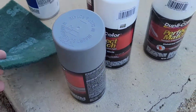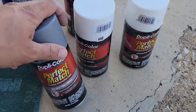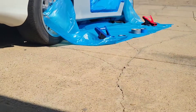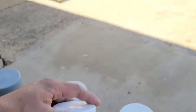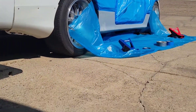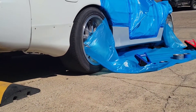I already primed it. What I did was wipe it off with a towel, then went over it with some Scotch-Brite, wiped it again, and threw some Perfect Match scratch-filler primer on there. Next I'm going to wipe it down one more time since it's been drying. Then I've got this Perfect Match Universal White — it matches pretty good. I did the little valence in the back and it looks decent. Remember guys, I'm not a professional and I really don't care if it looks too professional.